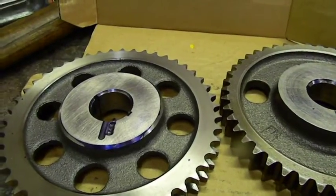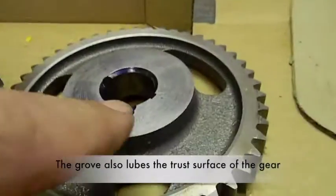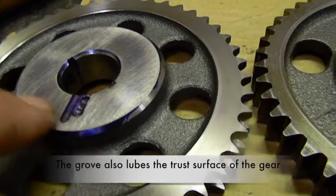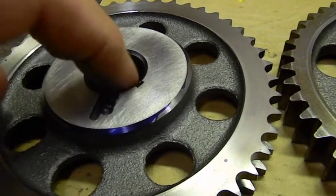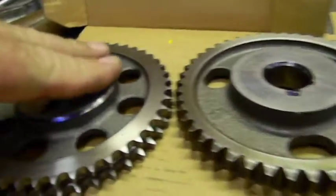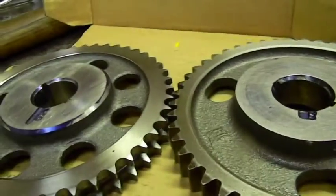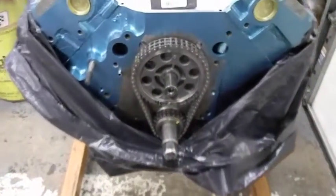Okay guys, we're done. This one is much deeper than the other one was, and that was tall enough — so they just went so much further. I brought it over a little bit, did it with a bunch of drill holes again, took off the shelf and the dividing wall. Checked it with the dial indicator — we're good. Let's put this bad boy in.